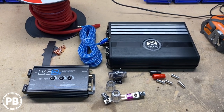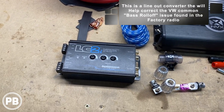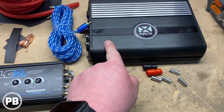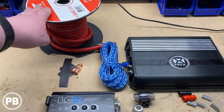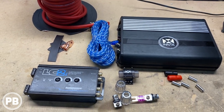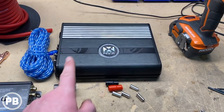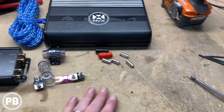The parts we're going to use for this install: first of all, an LC2i. This helps us restore some of the bass roll-off that's commonly found in these Volkswagens. This is our line-out converter that'll take signal pulled from the factory radio, feed it in here, and output corrected signal from the bass output to our amplifier. We have some RCAs, and some bulk wire — though if you pick up an amplifier wiring kit, it'll come with all the bits and pieces wiring-wise that you'll need. The amp we're going with is this NVX 750-watt amplifier. We have an unboxing on the channel if you want to check it out in more detail — we'll throw a link in the description. We also have our fuse and some odds and ends. We're using wire ferrules, running this through the firewall and battery through an inline fuse.